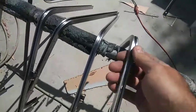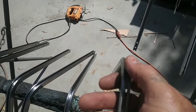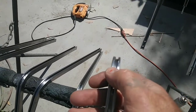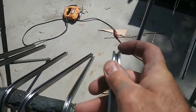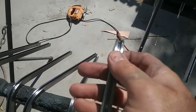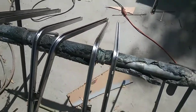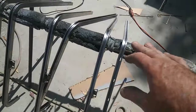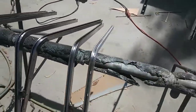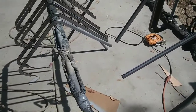You absolutely have to do this with brand new pop-out windows. Look at the original frames and see how they're square across — they're crimped in. Look at your brand new frames; you've got to do this before you send them out for powder coating. Make sure you crimp those edges out. I'll talk to you in the next video.